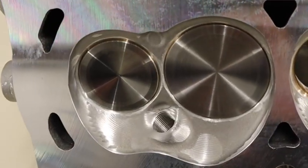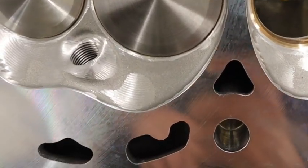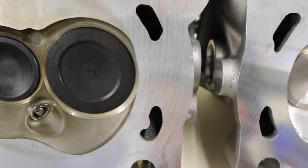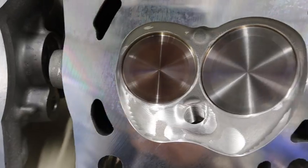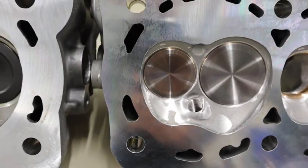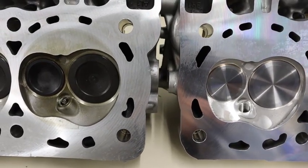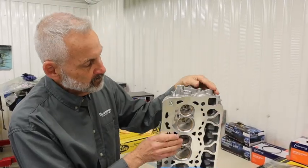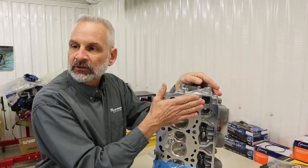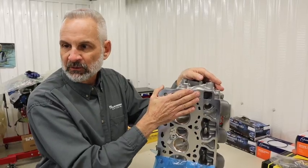We'll see if we can get it side-by-side with the stock head on the boss for the spark plug. That kind of protruded, and it had Dave Visner and myself a little worried that on really high cylinder pressures it might become a hot spot. So we cut that back a little bit so that we have less uncooled cast aluminum in the combustion chamber. These are really set up to be standard surfaces, so we're not trying to get any more volume out of the chambers on these.